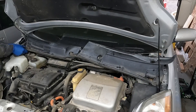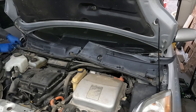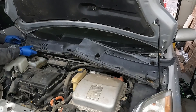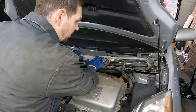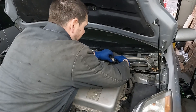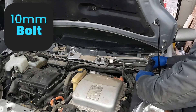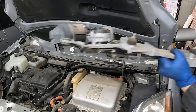Come over to this side. Now this vehicle does not have clips on the side, but if you have clips there may be one on each end. Now we'll remove our wiper motor, unplug it, and then 10 millimeter bolts. Set this aside.